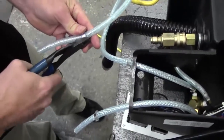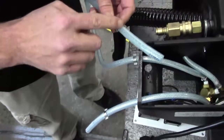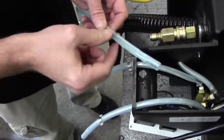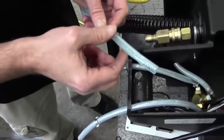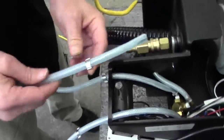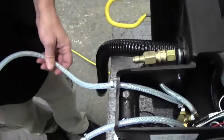If you were to get a metering tip sucked down in there, you can actually just squeeze it out using some pliers on the side of it — as you squeeze it, it's going to work itself out. If you take the hose and dip it down into a cup of hot tap water just to soften it up a little bit, that will help you get it out a little easier.